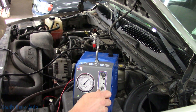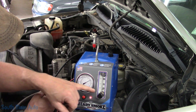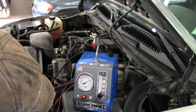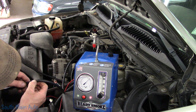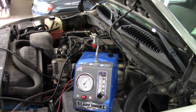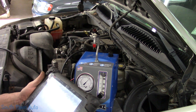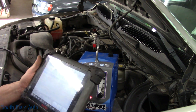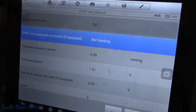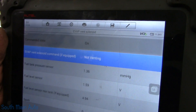Plugged in. Now we're going to grab the scan tool. Our flow gauge is at full beans — if it drops to zero it obviously means the system is sealed. The gauge gives us an indication of the size of a leak — 10, 20, or 30 thousandths. Pressure is reading about 10 to 12 inches of water, about a third of a PSI. We're going to seal off our new canister vent solenoid, commanding it not venting. We should see an increase in tank pressure, which we do. We know there's a leak so I don't expect our gauge to hold. Tank pressure is at 1.36 millimeters of mercury. Let's get it up in the air and find the leak.